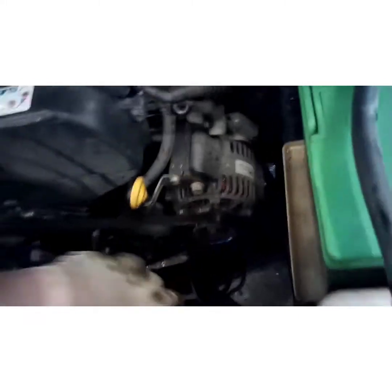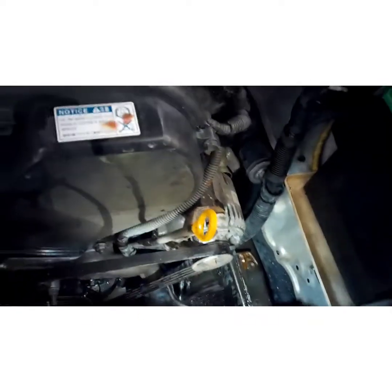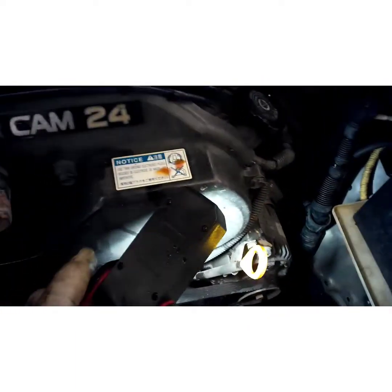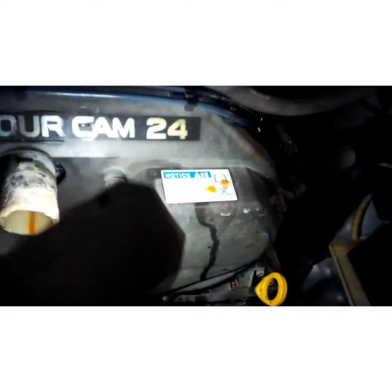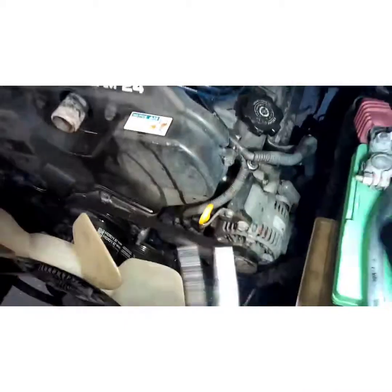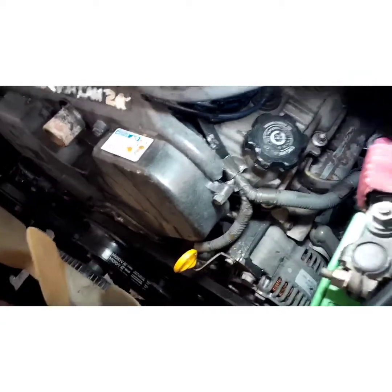And we're going to be replacing this lower hose too, so I'm going to go ahead and take that off with these awesome squeeze clamp pliers that I can't stand. Or not pliers, but clamps. Worst design ever. And that's why, because they never want to slide over the damn hose. Come on. When the hose swells up, those clamps don't want to come off. Don't ever reuse those clamps. Ever. Alright. There we go. Alright, she's all apart.